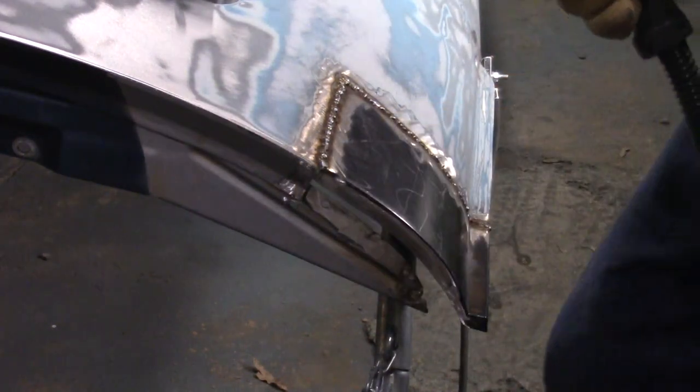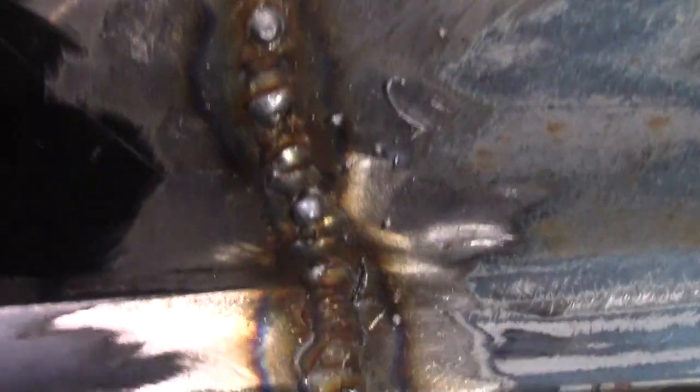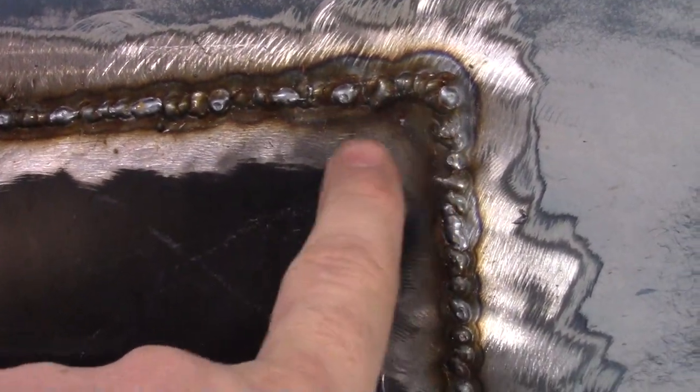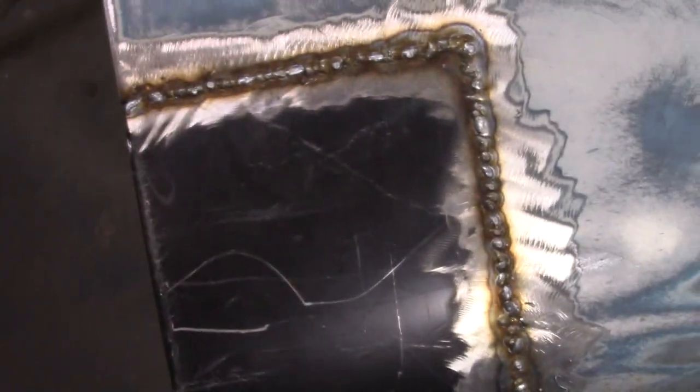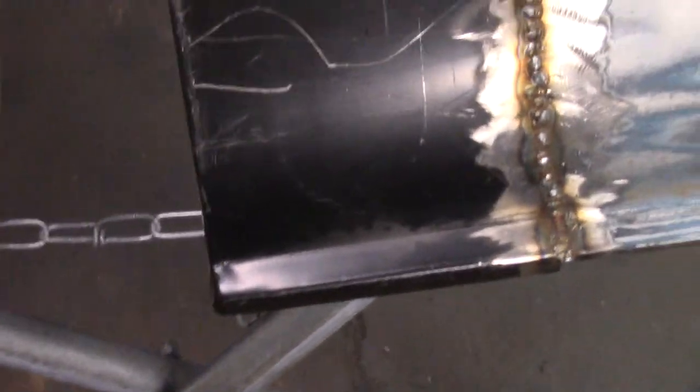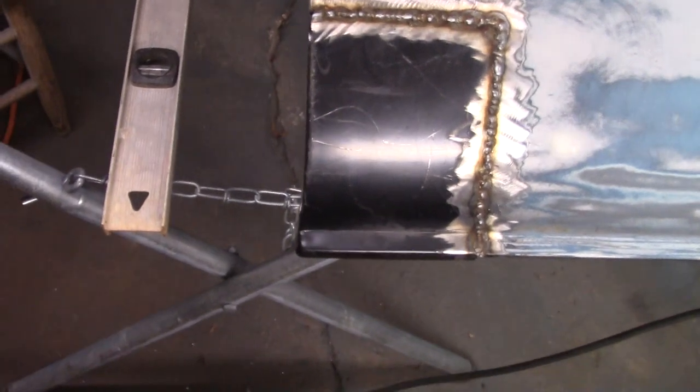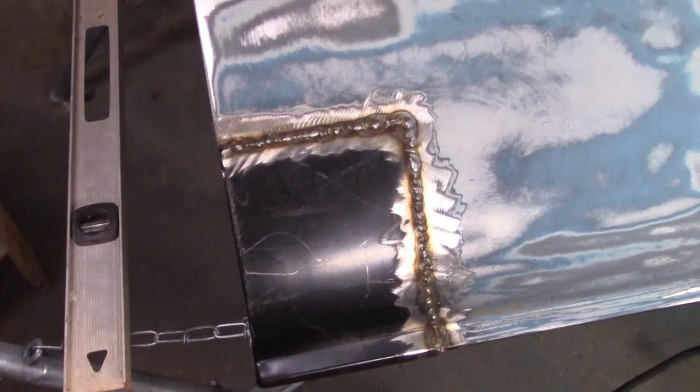All right, so I got it all except for right in the corner, and I'm going to leave that until I get this other piece of metal on here. I've just tacked it around all the way down as best I could on the bottom. Now there's going to be some body filler — going to have to fill in a hole, a little indentation right here. There's probably going to be a lot of body filler across here to be honest, just to kind of smooth it out, because it ain't the best patch job I've ever seen. But I reckon it'll do. Thanks for watching, and next time we'll try to get this other piece on here and get it body filled. Until then, thanks for watching — please rate, comment, subscribe.